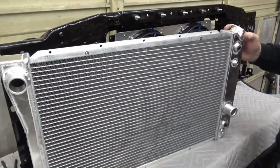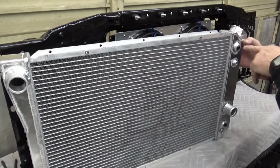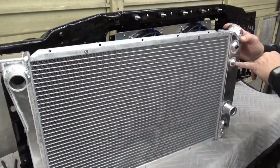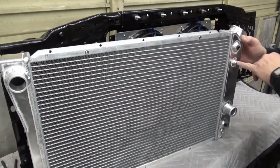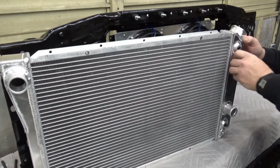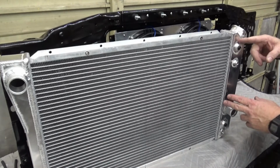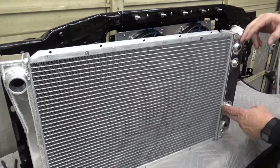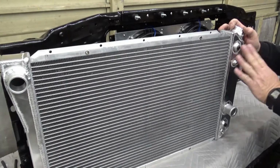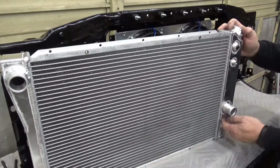And on this radiator also, I took the straight fitting out for the overflow tank and tapped it to 1/8 inch pipe so I could get a 90-degree elbow in there and keep everything trimmed down. This fitting here, that's for my steam port coming off of the LS motor, and I tapped it with a 1/8 inch pipe tap, and also cut the head off a little bit because it was for a big push-on hose. Now this radiator came with the integrated transcooler, which is basically a tube that goes inside this cavity, and I blocked that off by dropping a couple of O-rings in there, and then put some flattened off 1/2 inch 20 thread set screws in there. That's what thread is in these ports, 1/2 inch 20.